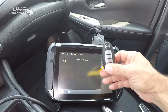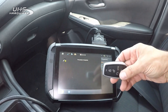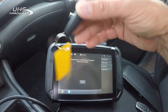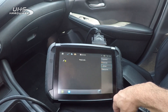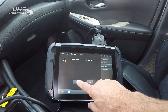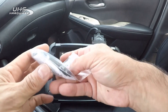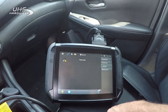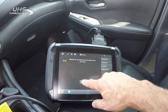Part three. We are just going to do the two originals and our OEM refurb — not worried about the aftermarket key. Going back to add keys, yes we're going to delete them all. We're going to analyze the yellow key — yellow key is good. Now the white key — white key is good. Now we're going to do our OEM refurb; I just left it in the package so I knew what was what. We don't want to analyze another one.